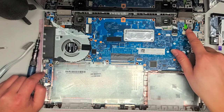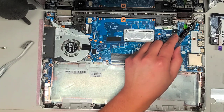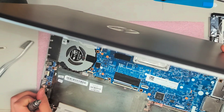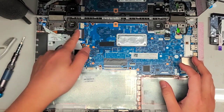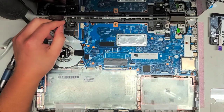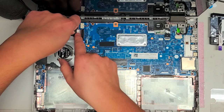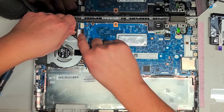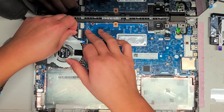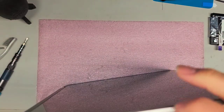The cable is probably not damaged on this side. It's more likely it came loose, or it got damaged on the other side, or the screen itself got damaged, or possibly even the backlight circuit. I don't know why this tape was up like that when I opened it — maybe someone opened this and did something to it. So I'm going to check these connections. That's for the power button, this is for the webcam, and there's the charge port connector here. It looks like it's underneath the motherboard with this metal thing — kind of bad design.